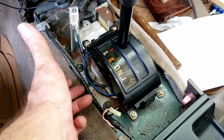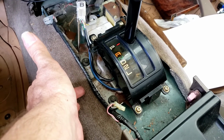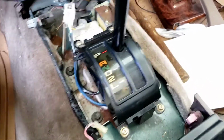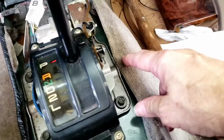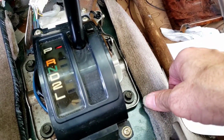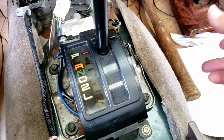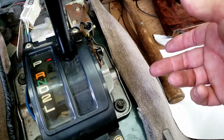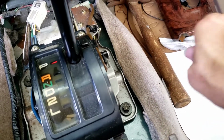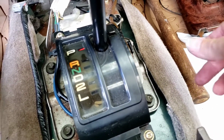I put the bolt back in. It took me a while to line it all up and get it in there. Once I got it in there, it was catching on the new bushing on this side, and it kind of damaged it. I was trying to push it through, so I had to take it back out again and clean out the shaft again and lube it even more with grease, even the bushing, so that when the bolt slid back in, it wouldn't catch on the edge of the bushing, which is what it did the first time. So the second time was a charm.